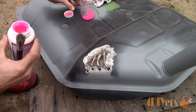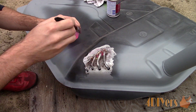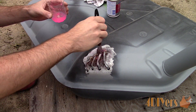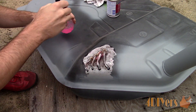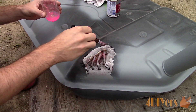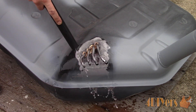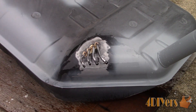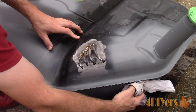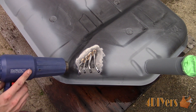Back to the leaking area — while it is still an awkward area to get a sandblaster into, some light rust may still remain in the pitting. I used a gel-type rust remover to help neutralize whatever was left. This can be applied with a brush and the solution needs to soak into the surface for a desired amount of time — this can vary between products so be sure to read the instructions. The product requires the area to be rinsed with water then dried immediately with a cloth. Finally I used a heat gun on a low setting to help remove any moisture. Compressed air can also be used. Do not use an open flame on the tank.